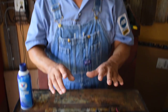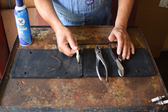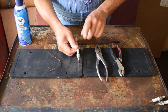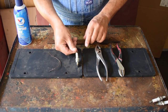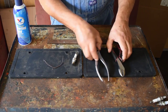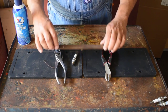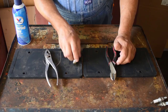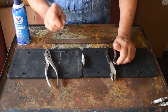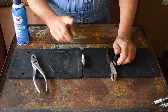Right over here, we're going to need a couple of things. We're going to need a spark plug — it doesn't have to be a new one, an old spark plug will probably be okay, but we'll have to test it. We're going to need a piece of baling wire, a couple of tools: some diagonal cutters, a pair of pliers, and a file. What we're going to do is make a secondary ignition voltage analyzer — we're going to make a spark tester.